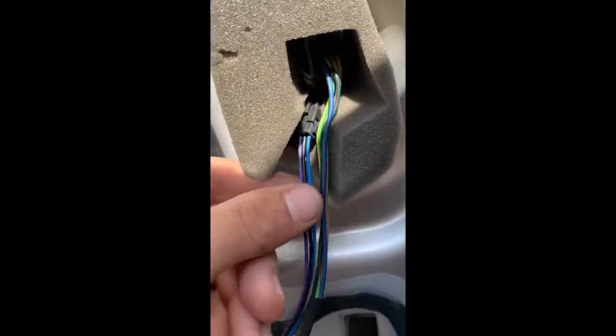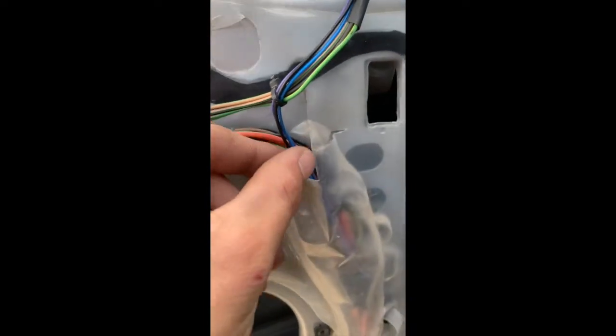All right, so I've now run my wires. Here's where the connection is. I ran it down with 2 zip ties to secure it in place. And here, I did a nice wrapping of a good amount of electrical tape to ensure that this thin steel won't rub a hole through the wire from vibrations and other stuff like that.